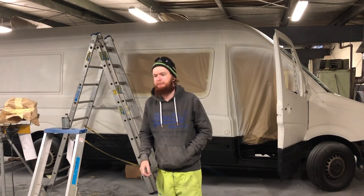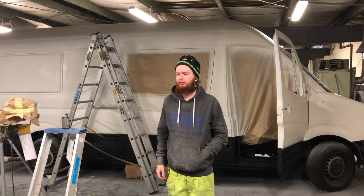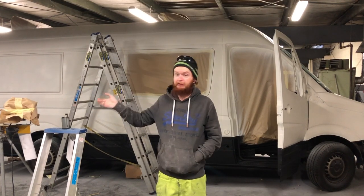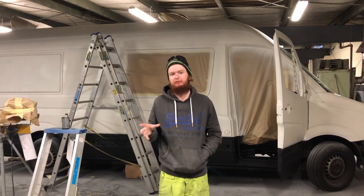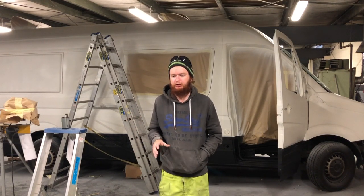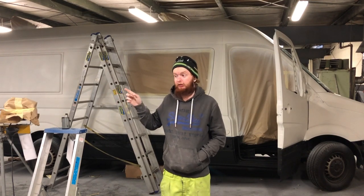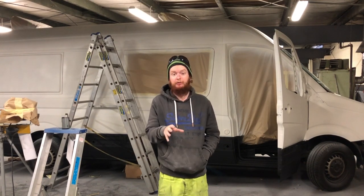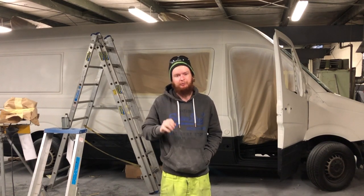We ran into a slight issue — we ran out of white paint. Not the best on my behalf, I didn't order enough. If you're doing a van like this, doing all the door jams, insides of doors, interior of the sliding door, the roof and everything — 12 litres is not enough if you're going for white. It might be if you're tinting it a dark colour, but with white it just didn't cover. We've got another 8 litres of white on the way to do the sliding door, finish it off, do the back doors, and give the whole van another dusting over to cover any spots where there's still a bit of primer coming through. It's very subtle but I know it's there and it'll wind me up.